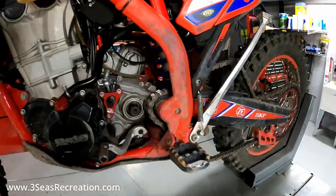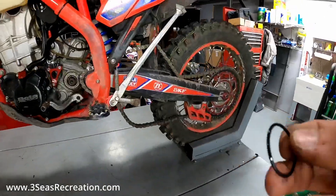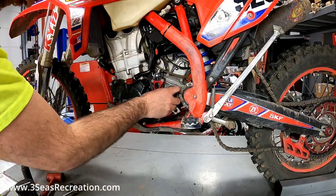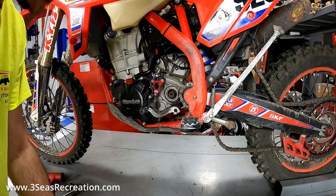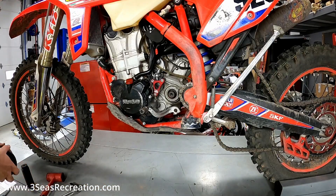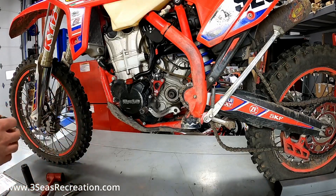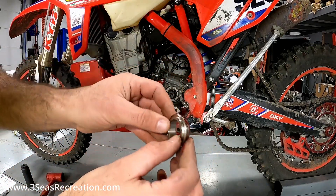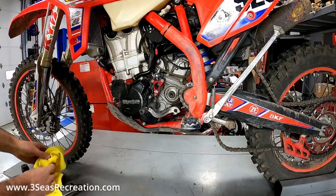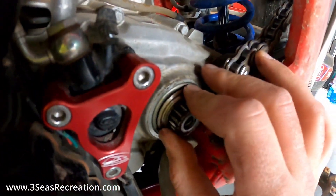Now that our seal is installed, all we have to do is take our new o-ring and push it back on the shaft to keep our oil from coming out. Now we're going to install our new spacer — I'm going to put some grease on this, I like to always grease these when I put them in. Now we got it greased up, we're just going to push this straight in and get it all the way in. You can see in there — it's super sweet. It gives us that longer, taller collar to keep the mud from going down in there.